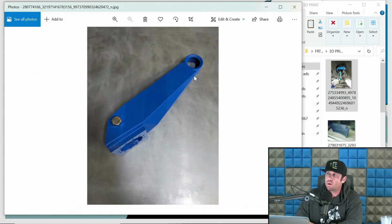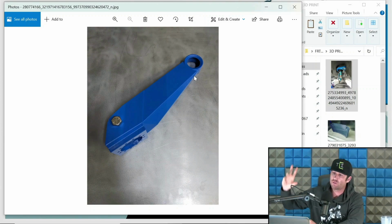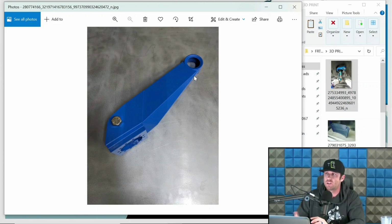And like here's the upright. We didn't put steering on it yet in this specific example because our goal right now is simply to check the overall assembly of travel, camber caster curves, and the shock package. We're trying to stuff a lot in the front of this specific F-150, so it's kind of a pain, so we want to make sure we're all kosher.